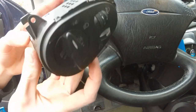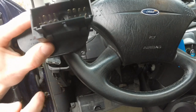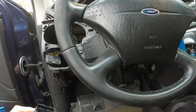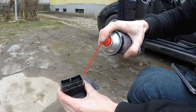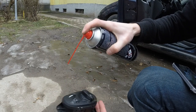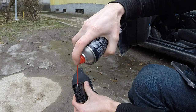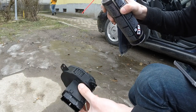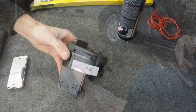Congratulations, now you have the switch in your hands. If you want to replace it, there you go, but I will need to clean mine. Just as I said at the beginning of the video, I have contact problems — my dash backlight just goes out randomly, but if I turn the whole thing off and back on again it works. So I got some contact cleaner spray and sprayed the connectors. It works now, at least for me.